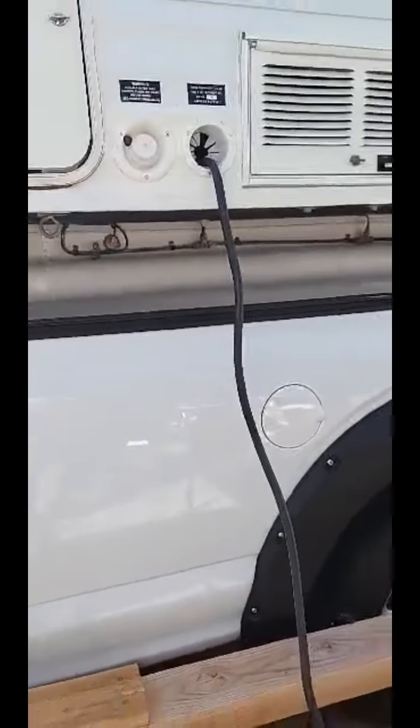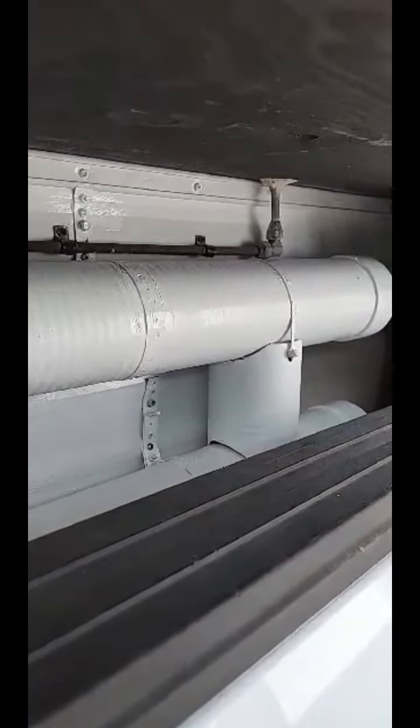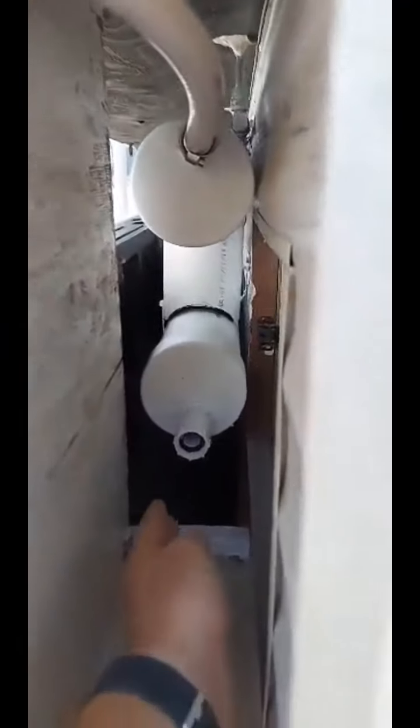Okay, one final tank video. I've actually got the camper raised up 6 inches out of the bed, so you won't even see half of this when it's down. But all installed, came out nice, fits in there good. It holds 7.5 gallons of water, which balances against my fresh real nice. I've got a 5 gallon fresh water tank, so having 7.5 gallons of waste is perfect for doing the dishes. I've got this little access part here, and this goes right up into the sink. It's not a complicated system, and when I drain out, it'll be down here. And that's how it went.